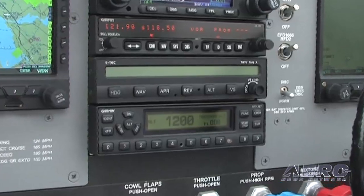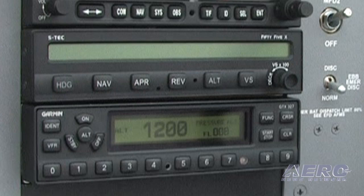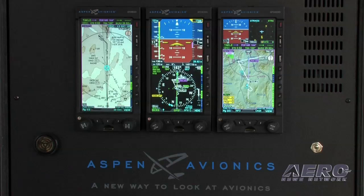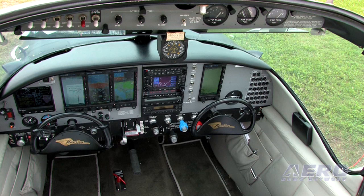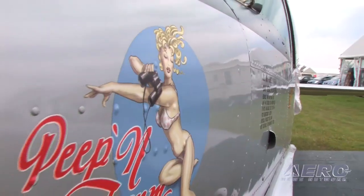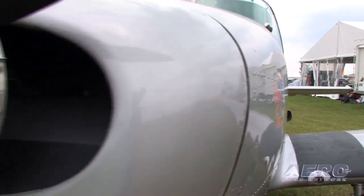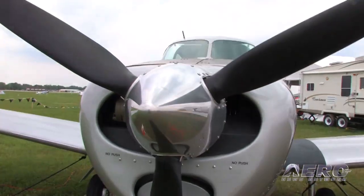How about interfacing with your radio stack, and is there an autopilot on board? There is an autopilot — we have a STEC 55X, and again it performed admirably. Using the GPSS mode in heading, there's no work, just monitoring. Using the 55X in the VNAV mode, we could start our descent to avoid shock cooling the engine. We started maybe 60 miles out, told ATC we wanted to do a slow 300-foot-a-minute descent, and it just brought it down, vacillating maybe within 20 feet above or below the descent altitude. It was great.